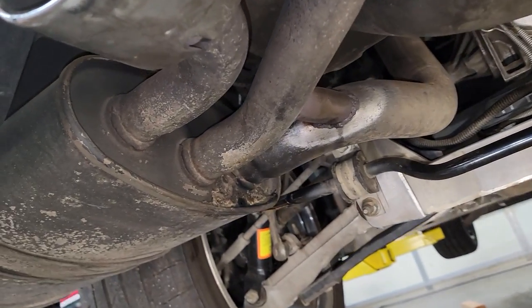Keep in mind, I've also added the exhaust bypass modification to my exhaust, and that frees up a little bit of back pressure, and it also sounds a bit more aggressive without sounding obnoxious. Second, most aftermarket cat-back exhaust systems for the C5 utilize the same 2.5-inch diameter pipe that comes with the stock exhaust. And since I have the exhaust bypass modification, even if the Corsa or the Billy Boat or whatever had a freer flowing muffler, it's still not gonna add any horsepower over this setup.